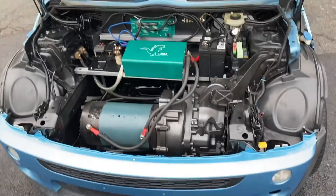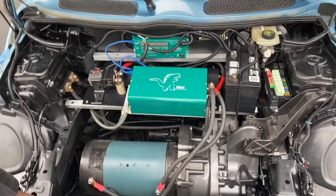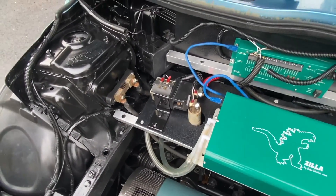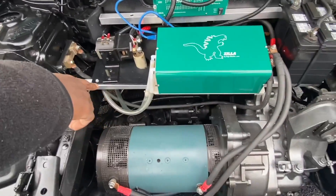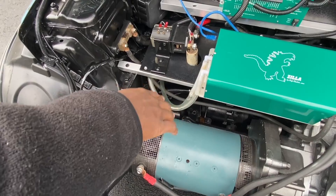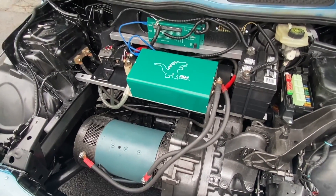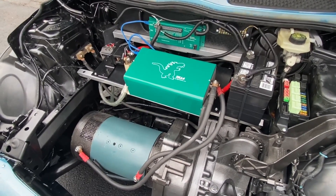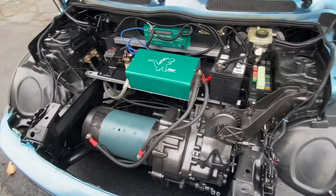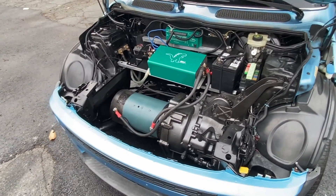I gotta admit — this is pretty damn clean. For a thrown-together budget EV, it's pretty damn clean. The wiring's nice and tidy now. The main contactors are there — we still need a box for that, because that really shouldn't be exposed. There's a heat exchanger, a small radiator I have, but I didn't have long enough tubes to go to the front, so I just stuffed it underneath — something I have to take care of. I also put a bigger controller on there. I had the Zilla 1K, but this is a 2K with high voltage. I traded a guy — gave him my Zilla 1K plus $100, and he gave me this one because he didn't need it for his application. For a DIY EV for a few grand, this really isn't that bad.